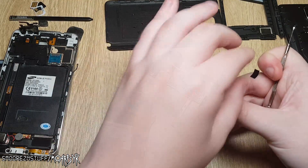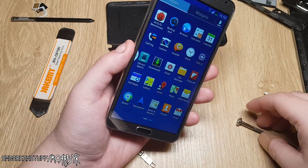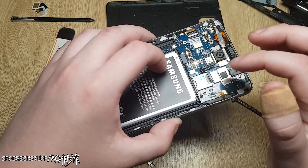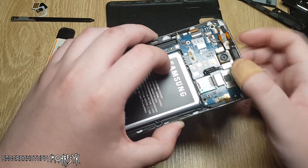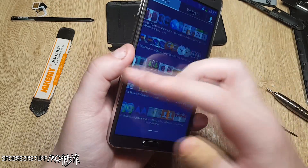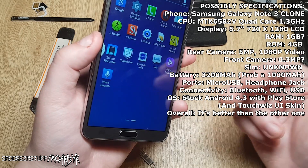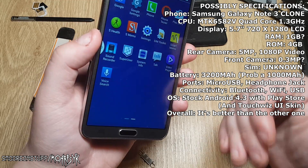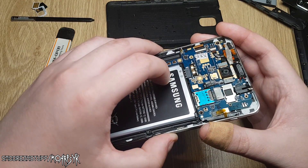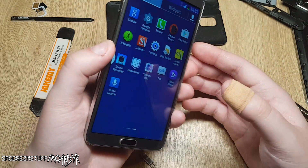Alright, I'm going to put this thing back together and start disassembling the other ones too. I've switched the phone back on and it all seems to work. I've done a little bit of research on the MediaTek chip. It appears it can take up to 2GB of DDR2 memory. The problem is I can't tell if it's 1GB or 2GB in here — I'm going to lean towards 1GB, just because that seems more reasonable. So at this stage it's a quad-core, 1.3GHz, a 720p display, and either 1GB or 2GB of RAM with 4GB of storage. Not too bad of a phone. As for the SIM card, this ribbon seems connected properly, but I've tried a SIM card and it still doesn't want to connect, so I've got no idea.